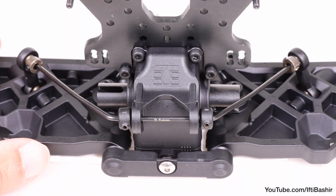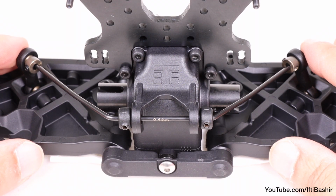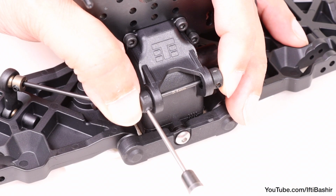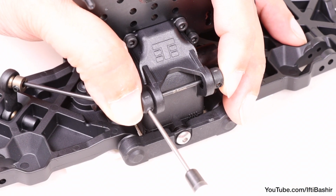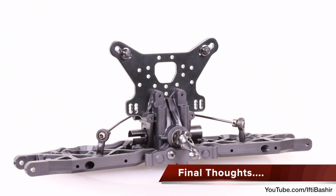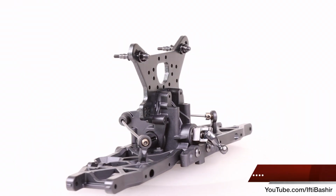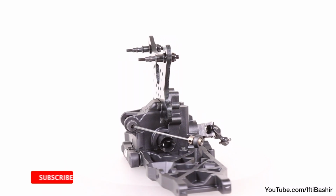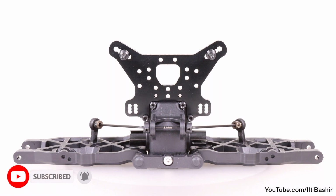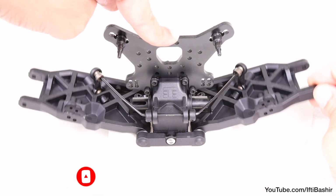All that's left is to place on a flat surface, ensuring the sway bar is as centered as possible, and tighten down the two sway bar screw mounts we left loose earlier, now securing it into place. And that's the rear end assembly and Bag E complete. The vehicle is starting to take shape nicely now, and although we're 5 bags in, everything has pieced together with perfection, no issues at all.